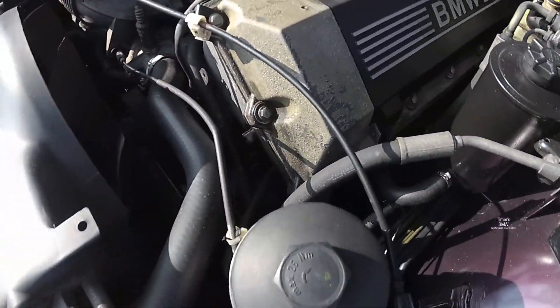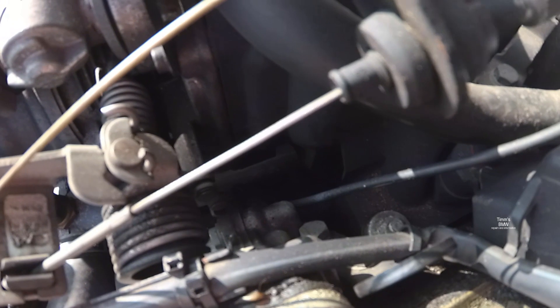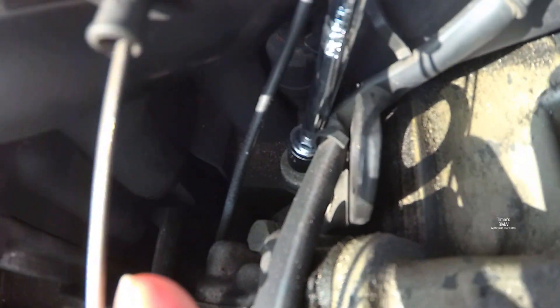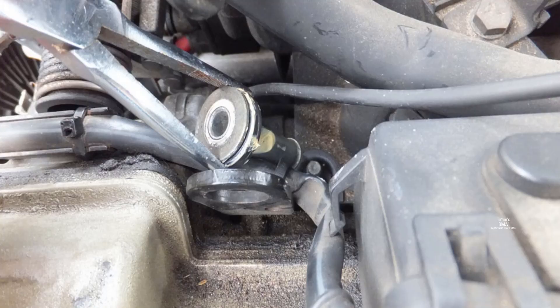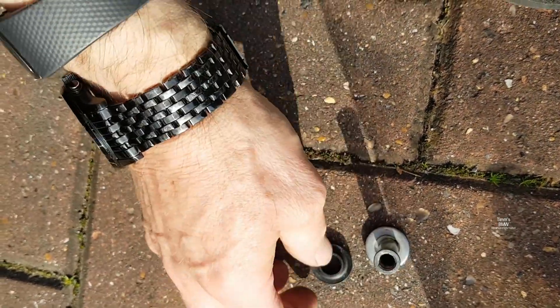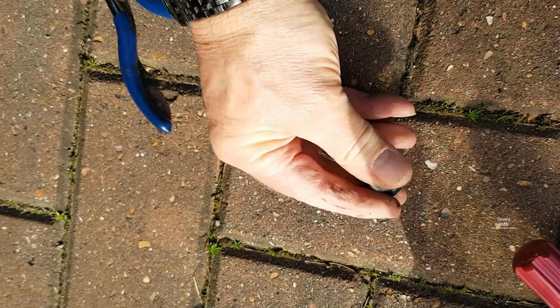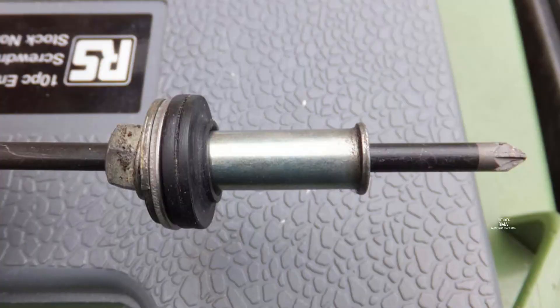So a 13 mil nut, as far as I remember — 13 mil socket — and it should come off with a bit of a 'ting' as it comes undone. There we go. Long nose pliers pull out the hollow fixing. What we do with this hollow fixing is take off the rubber compression piece, and then we're going to add that M12 washer — available everywhere. Then we put the rubber compression piece back on.